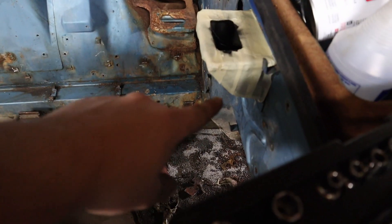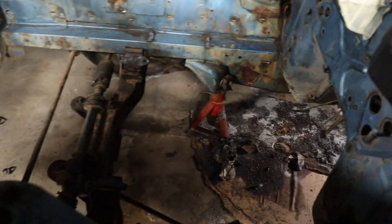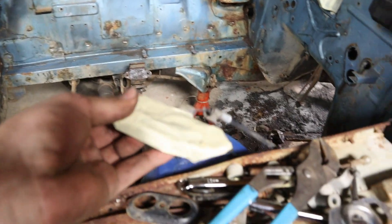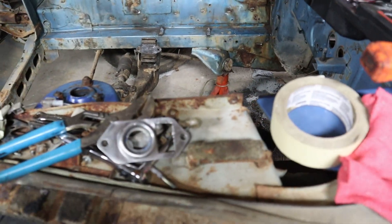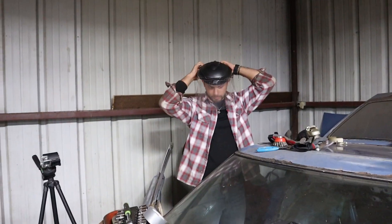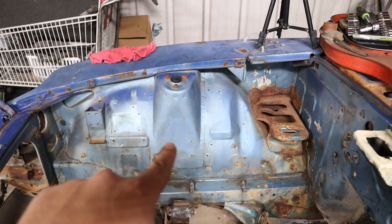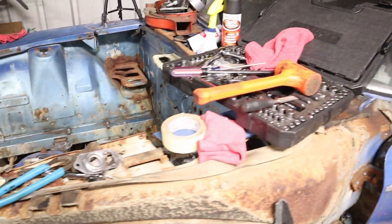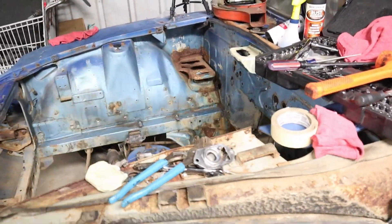We taped this off, as you can see in the time lapse, and put some rust reformer in there so I don't have to worry about anything going on inside. We also taped up the little mechanism so it'll be good when we paint. I just ordered the paint — it'll be here in a couple of days. The last thing we're doing tonight is cutting out the rust spots on each side. We'll wire wheel around them so tomorrow I can create patch pieces, weld them in, flap disc them, and you'll never know they were there.